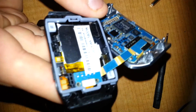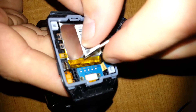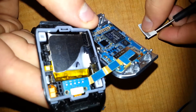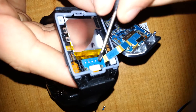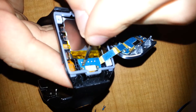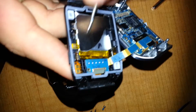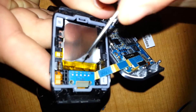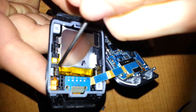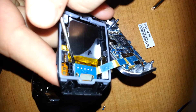After doing so, you're going to take your flat head and gently move the sticker. Gently move this ribbon cable. Lift up, and you're going to want to get into the groove of the bottom where the battery is on this chip and gently lift up.